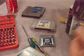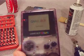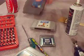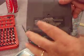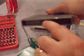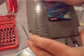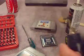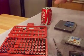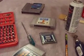Here's a game I had earlier — Star Trek — that also did not work at all. I gave it a good cleaning and it was good to go. The Nintendo NES games are the same: three screws, take those off and you'll have the circuit board with terminal strips on the top and bottom. Same procedure — use an eraser first. If that takes care of it, great, leave it alone. If not, go for the Dremel, but be very, very careful going back and forth across the contacts. You don't want to rip your terminals apart. And then the last thing you need to make it all worthwhile — a can of cold Coke. Take a sip, take your games, and go play. That's it.